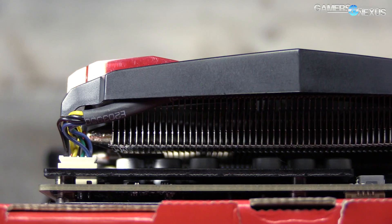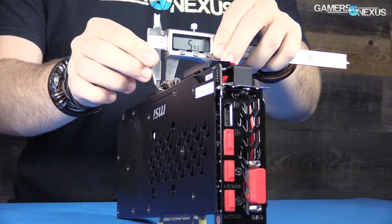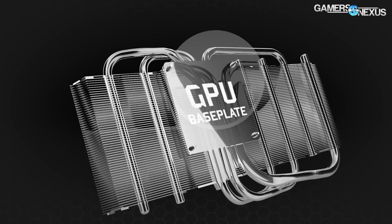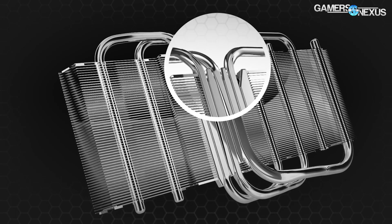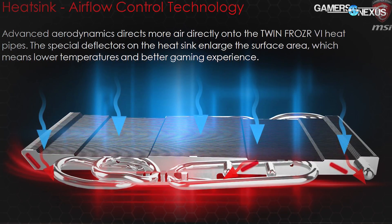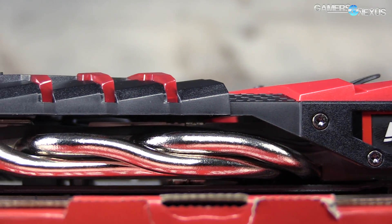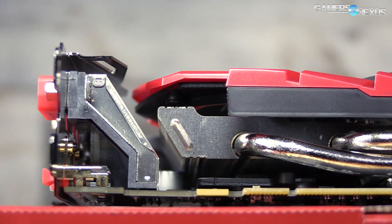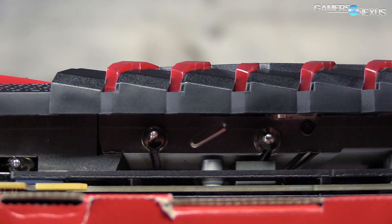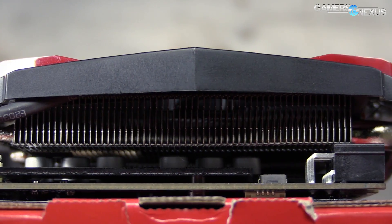The PCB is also wider, allowing a huge aluminum heatsink to be accommodated. There are three copper heat pipes, nickel-plated — two 6mm pipes and one 8mm pipe. The heat pipes square out towards the cold plate, ensuring contact between the heat pipes and the aluminum fins that spread heat. Greater surface area has been the primary push for this generation of AIB partner coolers on both AMD and Nvidia GPUs. A base plate sits under the cooler making contact with the FETs, helping with VRM dissipation and providing structural support along with the flanking backplate.